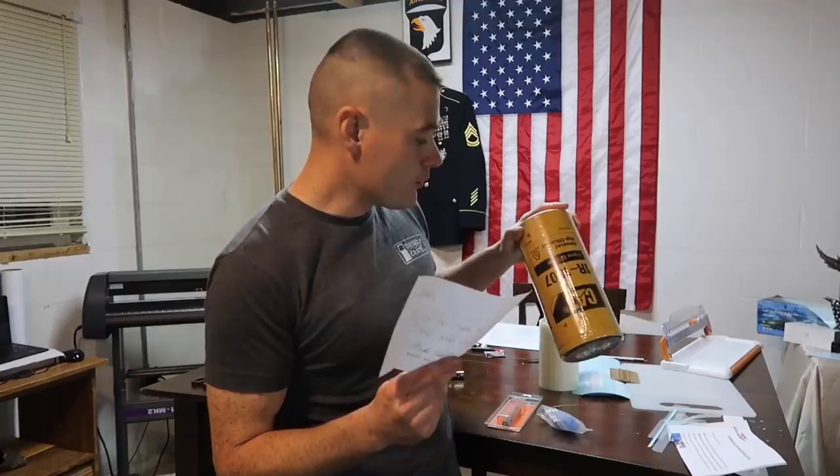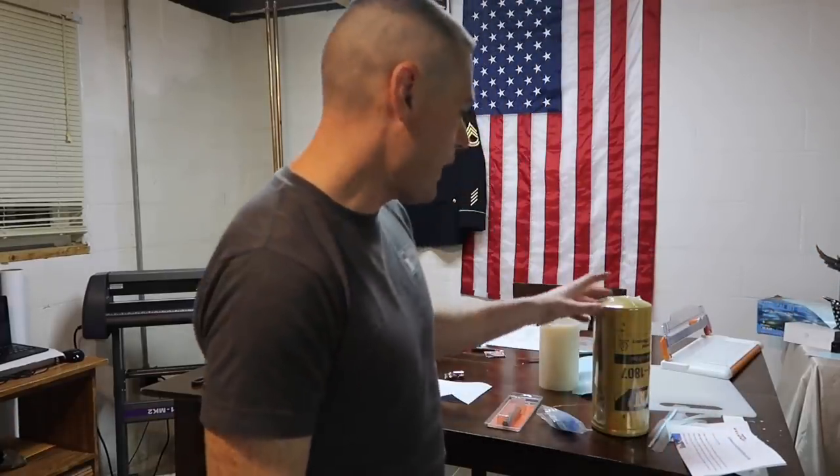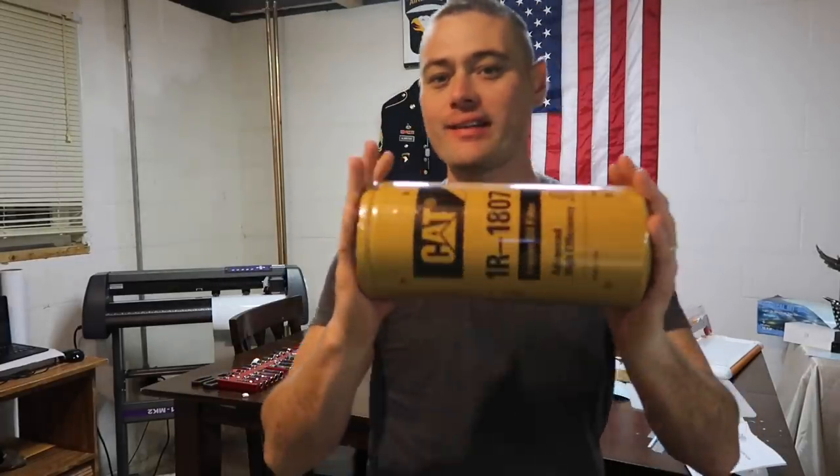With this kit you can't just install it on your normal oil filter housing — I'm going to show you how to do that, so make sure you stay tuned. The reason I'd be installing this: longer filter and oil life, less frequent oil change intervals, 10% more oil capacity meaning you're adding an extra quart of oil — whether synthetic or regular diesel oil like 15W-40 is your call. It also gives you two times over-filtration, and it has a nylon center tube to prevent metal contamination — the OEM is aluminum. These CAT filters are also a lot cheaper than your normal standard oil filters.